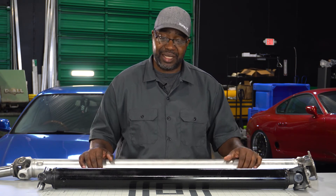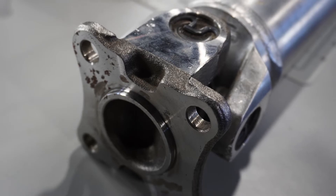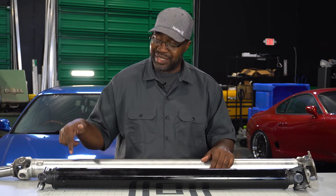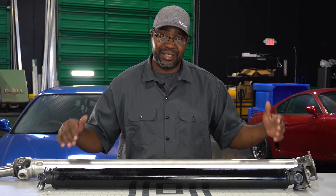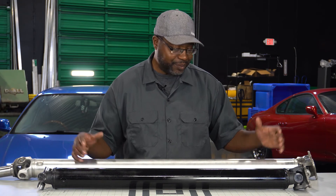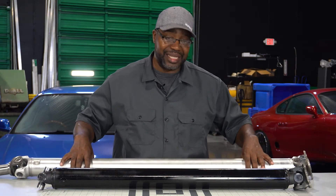On the aluminum shafts, we use a thicker wall. If you're getting a thin-wall aluminum shaft for less than the price of a steel shaft, ask them the wall thickness on their aluminum tubing. Thin wall — like what domestic factory shafts use, even those big three-and-a-half to four-inch factory shafts — doesn't have the strength to sustain continuous abuse or the higher horsepower and torque levels sent down the drivetrain. Our aluminum shafts are all three-and-a-half inch diameter standard, which is part of why aluminum is capable of holding higher torque and horsepower levels.